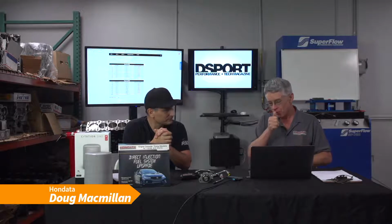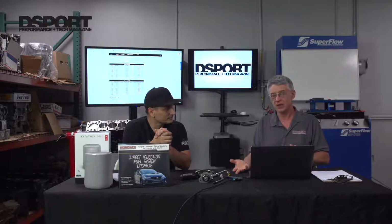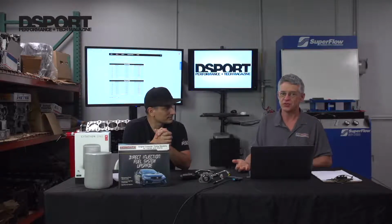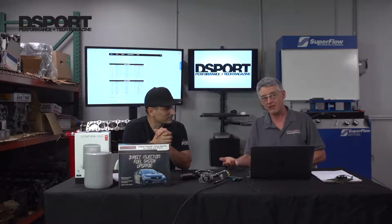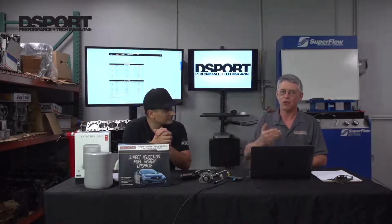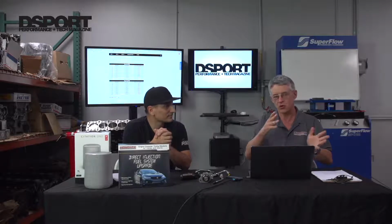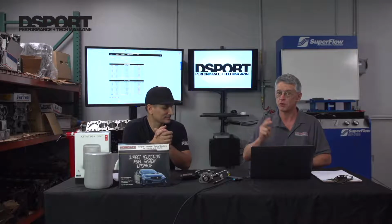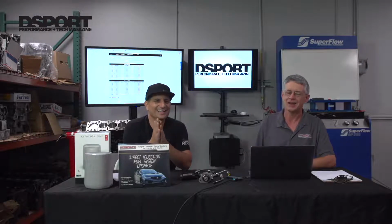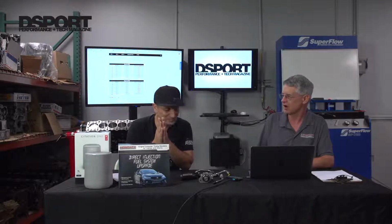When you go to fill up, if you want E50, you do 5 gallons of E85 and 4 gallons of pump gas. If you want E40, you do 5 gallons of pump gas and 4 gallons of E85. So it's simply a 4 to 5 ratio, and that's how you get your E40 or your E50. Simple. If you can remember 2 numbers, 4 and 5, you can get the exact ratio you need for maximum power and range. Very good.